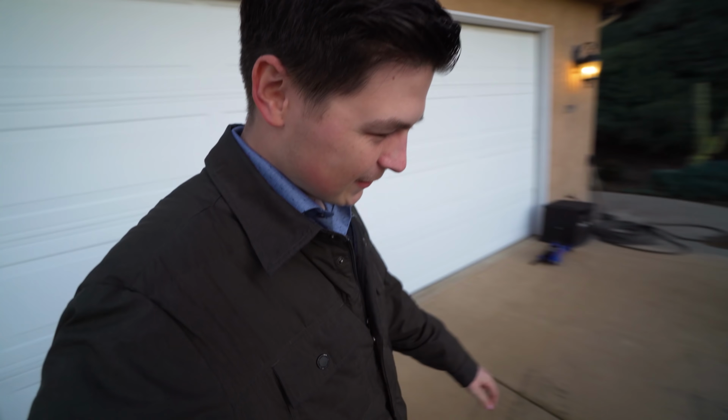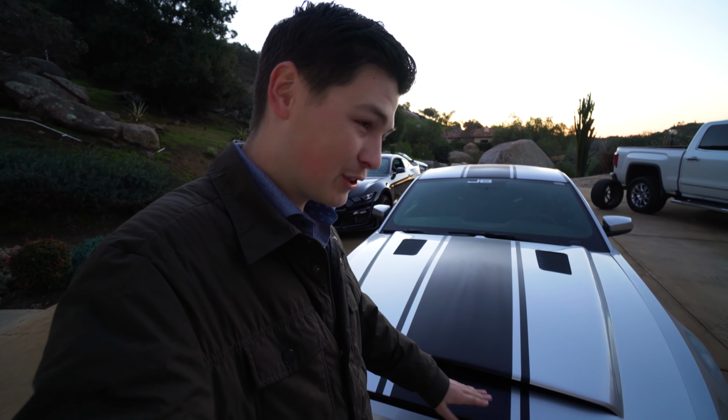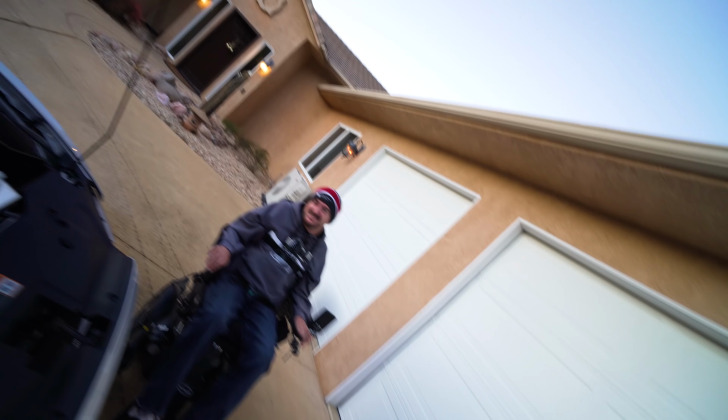It's this piece right here, guys. This main intake right here. It's closed inside, and I didn't know that, and neither did he. But I can see it right here, how it's opened up. Seems like the intake temperatures are a lot lower, more consistently, so the heat soak isn't as bad with the supercharger.